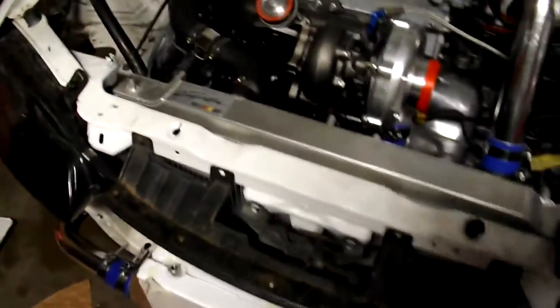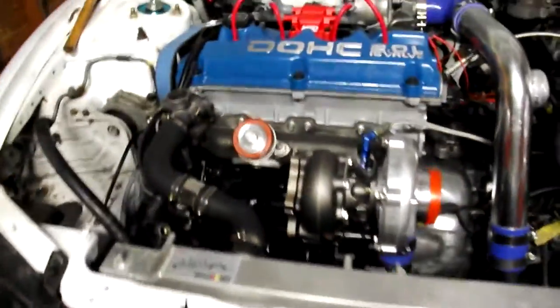What you do is once you cut that one peg off, sit it in, bolt it up. I have a Neon radiator hose top and bottom. When you install the Neon water inlet, the only problem I ran into is I had to bend the dipstick just a little bit. The dipstick bolts to the block and so does that inlet. I had to bend the dipstick just a little bit to line up with the hole right there. It's bolted on the bottom as you can see, and it's not really bolted on the top, but I had to line it up with that.